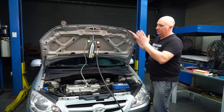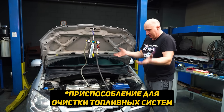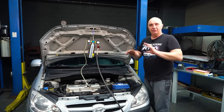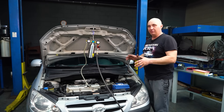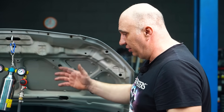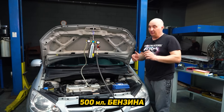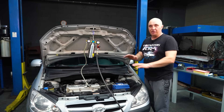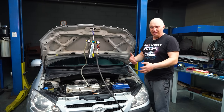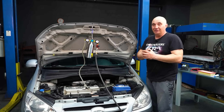For the sake of precision, we'll be using this sort of fuel injector cleaning system. I'm going to put in some gas, start the engine, allow it to warm up — that's to ensure consistency — at which point we turn it off, flush out whatever is left in the fuel rail, pour in precisely 500 milliliters of gasoline, start the car and allow it to run with no additional load. We'll see how long it's able to last, measure the voltage, and once all the gas is used up, we'll have a look at the timer.